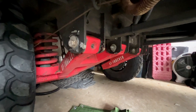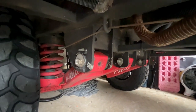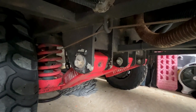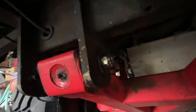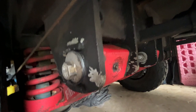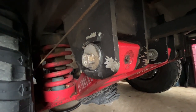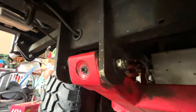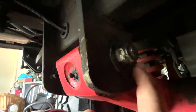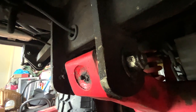I'm going to adjust that and try to bring it as far back to center as I can. There are two bolts in each rear sway arm or suspension arm — the first outside bolt is for the camber adjustment, and the inside bolt is for the toe-in toe-out adjustment. The two bolts in here are a 24mm nut on the inside, essentially a locking nut. This cam bolt rotates as you turn it and adjusts the swing arm up and down, which in turn adjusts the internal and external alignment of the wheel itself. When I checked, the washer on the inside was just loose — it was flapping. Because they're nylock nuts they're very good at staying on, but it had just worked its way out a bit — obviously what's been causing my issue.